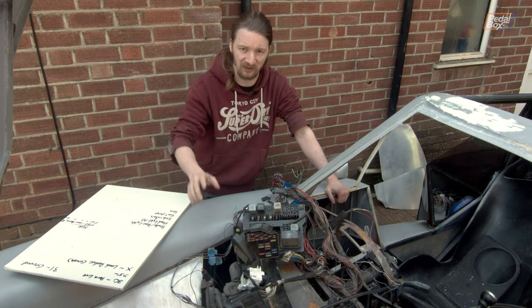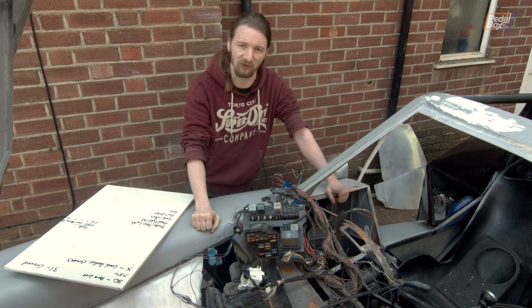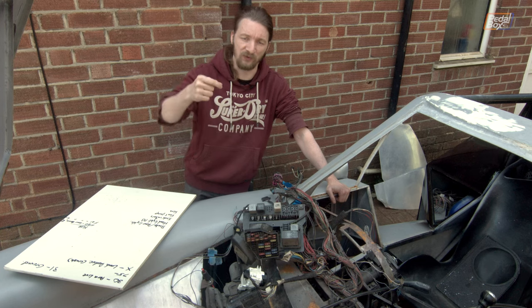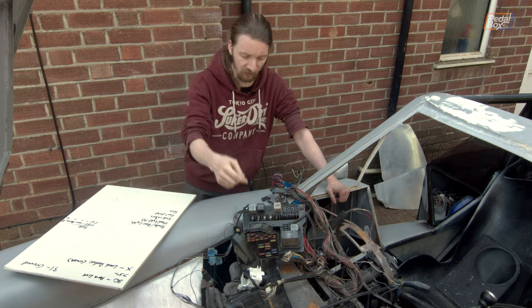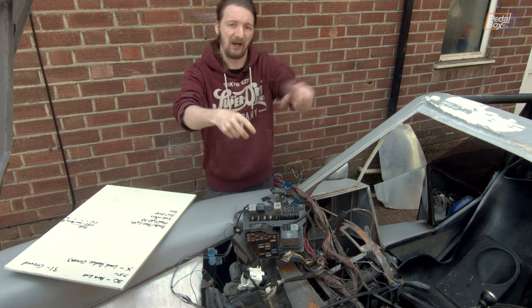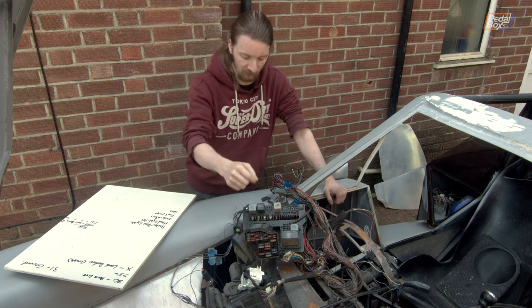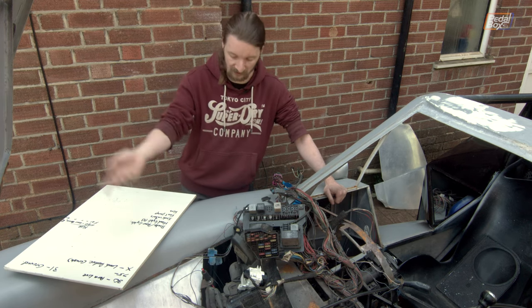The systems we're testing today are the brake and tail lights, headlights both high and low beam, indicators, and various other bits. We're going to pull the fuses and feed power into the outside of the fuse — no fuse in — to reconnect back through to the buses where other shorts might exist. We're going to pop the fuse, put 12 volts in, and just make sure the relevant things turn on, glow, spin up, etc.